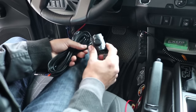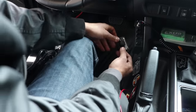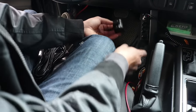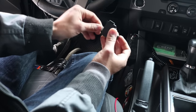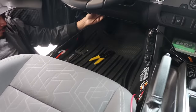If your amplifier has a subwoofer level remote knob like this one, you want to install it and run the wiring to the back where you're going to put your amplifier. I'm going to mount mine right here next to my CB radio. There are tabs to put screws through, but I'm going to use double-sided tape so I can remove it later without leaving holes. Connect it, mount it where you want it, and run the wiring all the way to the back. I put the clips back down and ran it through all the way to the back.